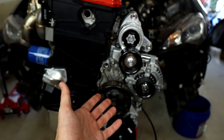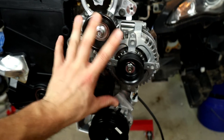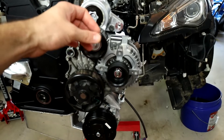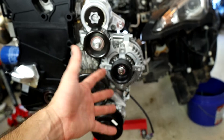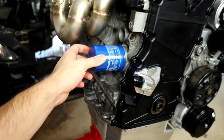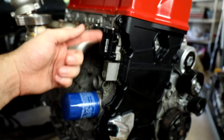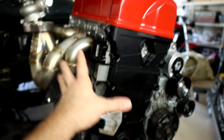Engines of all types have their own native frequencies at every single RPM. For engines that rev especially high like the K-series, which can be built to rev up to 8,000 or even up to 9,000 RPM, that frequency means you're going to run into a lot of different problems due to that excess vibration. One of the main problems is that the bolts on the outside of your engine, especially on your accessories, will start to back themselves out or wiggle loose - meaning your alternator might be loose making your belt rattly, or bolts feeding coolant and oil to your turbocharger may start to unwind from the engine.